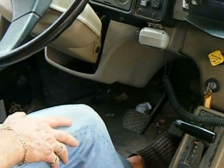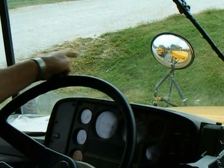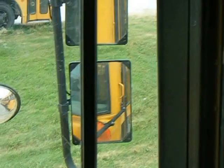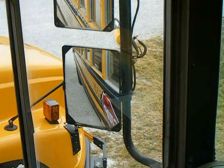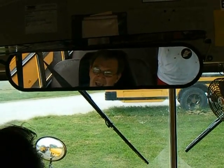I'm going to shut my bus off and look at my mirrors. My left convex mirror — you should see across the front of the bus and down the side. With the right mirror you should see the same thing: in front of the bus and down the side. On the west coast mirrors we've got two mirrors — the flat one, you should be able to see 250 feet behind you with the door closed. The bottom mirror you should see down the side of the bus and see your rear duals. On the driver's side, the top mirror you should see clearly 250 feet behind you; the bottom mirror you should see down the side of the bus and your rear duals. My rear view mirror is properly adjusted — you should see 250 feet behind you through the back glass. It's always good to keep your back glass clean for safety.